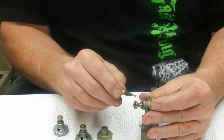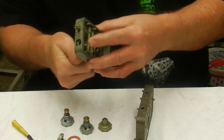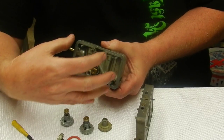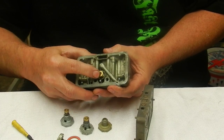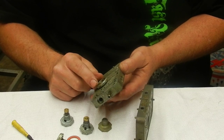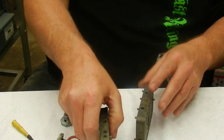This is just to clarify where the fuel flows around this tapered orifice here — it closes up. This screws on here just like so with a gasket. The fuel is on this side of the meter block; here's the bowl. When the valve is open, fuel is flowing right out of the bowl through here, and when it's closed it seals it off. Now, if this diaphragm ruptures, it'll make the engine run rich at idle — the power valve will stay open all the time and it'll suck fuel through the diaphragm, making the idle extremely rich. That's the only way it affects idle.